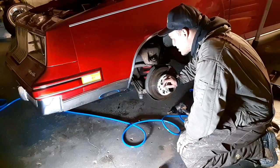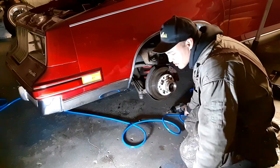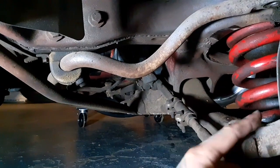For any rides that have airbags or hydraulics, it's a good thing to take it off because you definitely don't need it if you're trying to three wheel or go side to side. All right, so we disconnected the sway bar from the lower control arm and took off the bump stop.